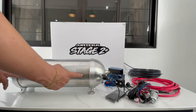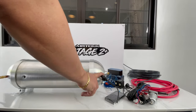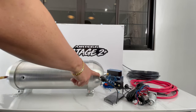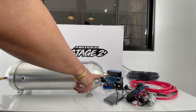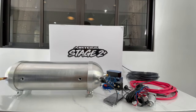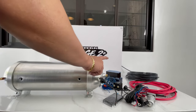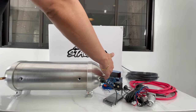On this side I've decided to put the pressure switch on top — I don't want to put it on the bottom. The reason is I don't want moisture to get on it whatsoever. If you do get moisture in there it gets rusted, or it could even plug it. Depending on the climate — say if you're in northern states with really cold weather — you can get ice in there and it'll freeze and it won't start your compressors.